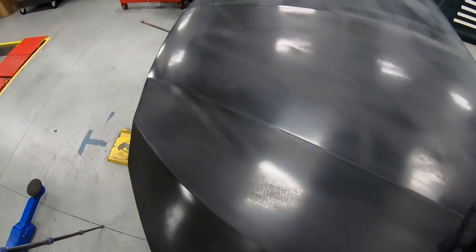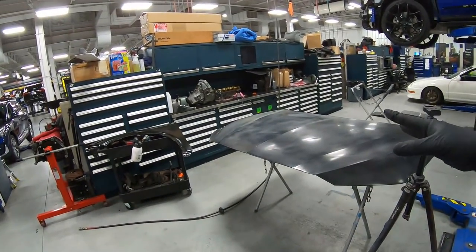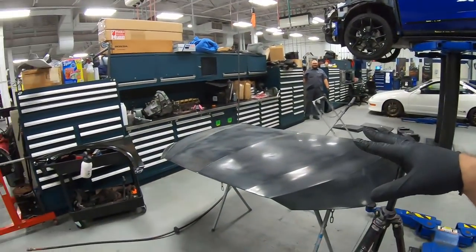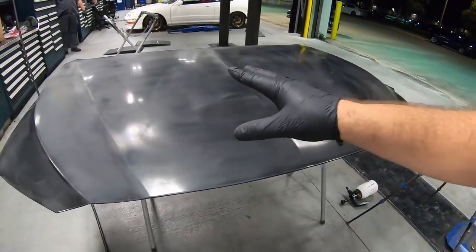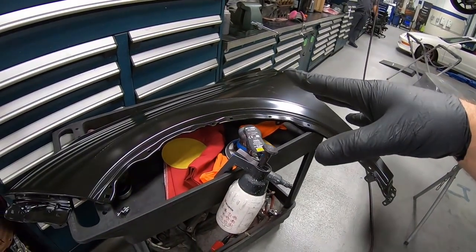Can you put paint right over this? Sure, but it's not the right way. If you put paint right over it, what you're going to experience is chipping down the road. The sealer is a cushion — it's also going to help with the coverage. When I put the sealer down on this panel, I'm going to be able to cover it in probably about three or four coats since it's a blue, as opposed to maybe six or seven if we're going right over this. So I'm going to use the correct type of sealer coat. For now, let's get this one scuffed up as well.